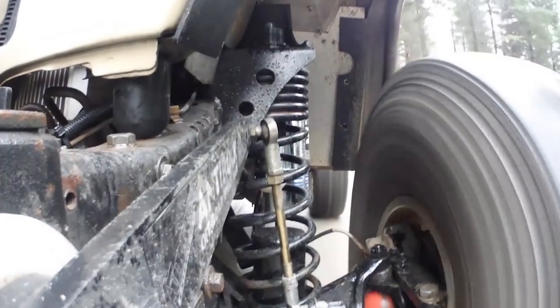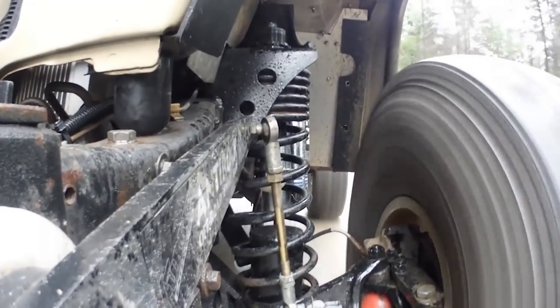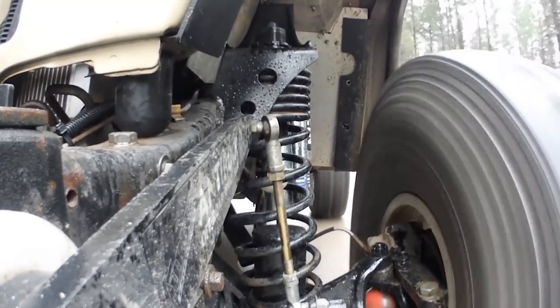We did two turns on the initial part of the stroke, and then I just did one turn on the little bit deeper part of the stroke. So this feels pretty good just on a dirt road. It's not too bad, really. I'm gonna have to pick up speed a little bit to see. Ah, it's a little harsh. Nothing crazy though.